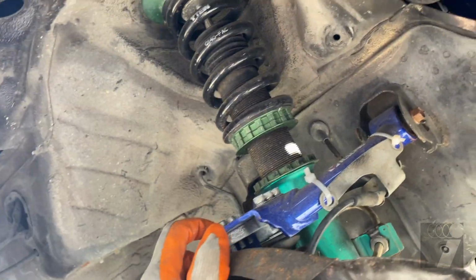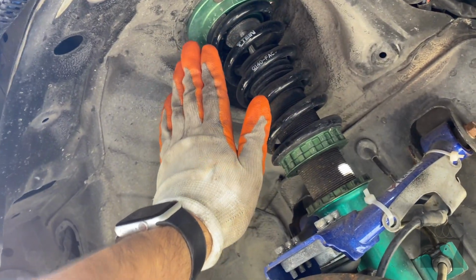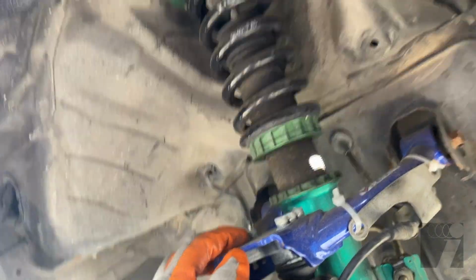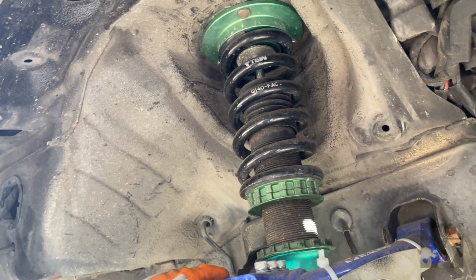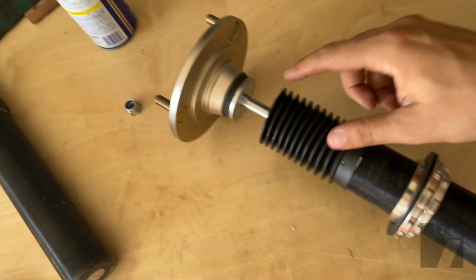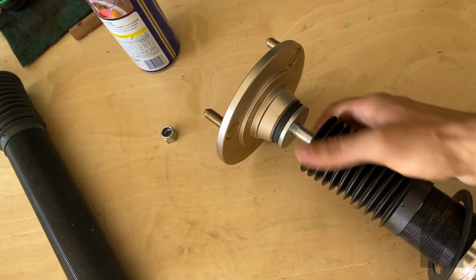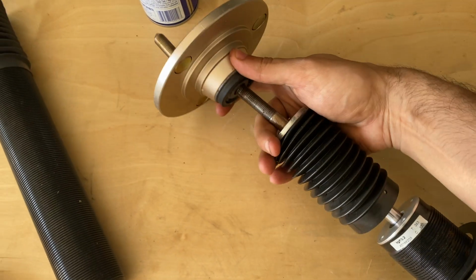So what I had in mind was to just get a camber plate up top to kind of push the strut over a bit. I'm thinking we'll get some clearance over here and kind of move the whole strut itself closer in towards the engine bay. Now the big issue there with these coilovers for the RX7 is they don't come with the capacity to mount the camber plate. So if you take this off,